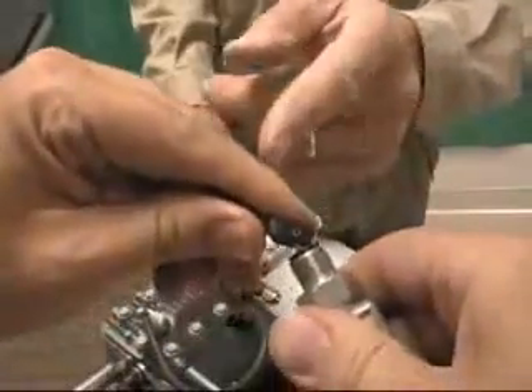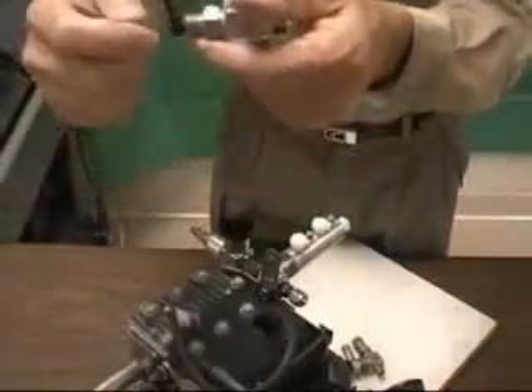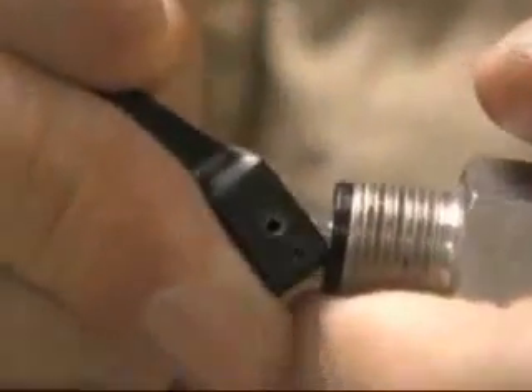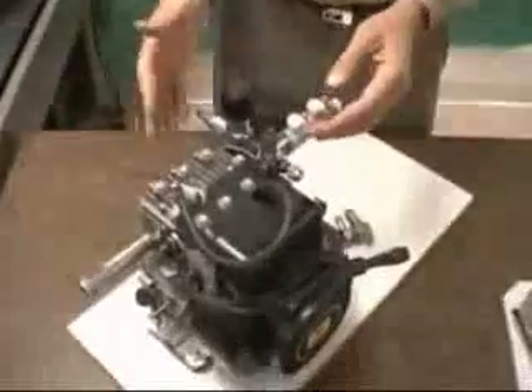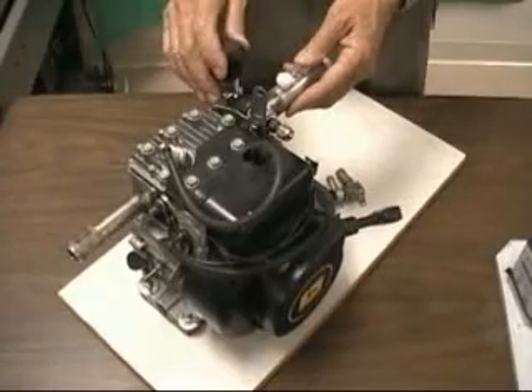This valve is equipped with a stop pin. When the pin's in place you can't take it to full open — it goes to almost full open but always comes back, making it handy to put on a foot feed position. The foot feed will still have mechanical advantage, and that turns out to be about the right tension. In any event, you can run it with a single valve or with two valves as discussed and still be under $25 in conversion.